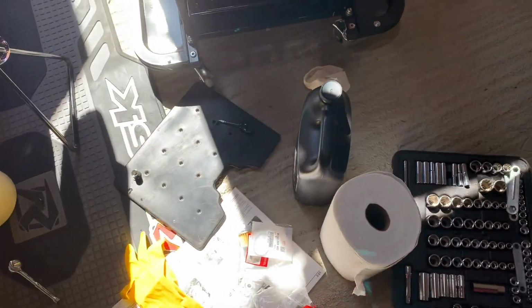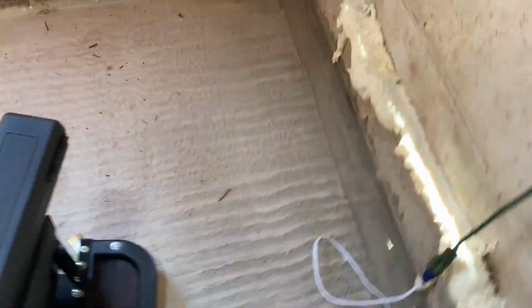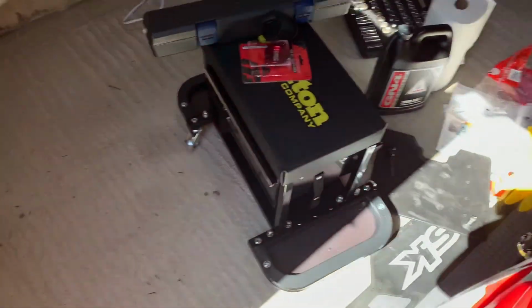But, what I did was I just removed that. And then I removed the bolt under there. And then drain this bad boy. I don't know how much I drained. Probably something like a liter. But yeah, there's the oil. What I'm gonna do now is rock the bike this way so more oil gets out, if you can.